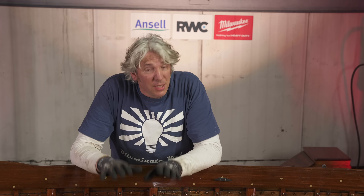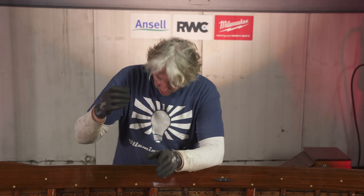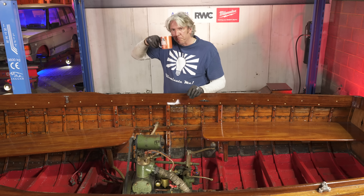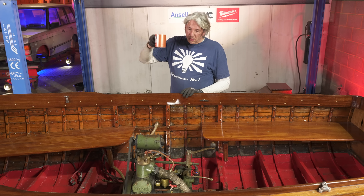Part of the success of this motor is really down to its simplicity. I mentioned it was a two-stroke motor, which means it hasn't got any valves or cams or anything like that. The way it can actually open and close the exhaust and inlet ports is really by the movement of the piston. So if I get myself a stunt piston — a very tasty one at that — you can imagine the piston moving up and down inside the cylinder. There are no valves, but there are ports.